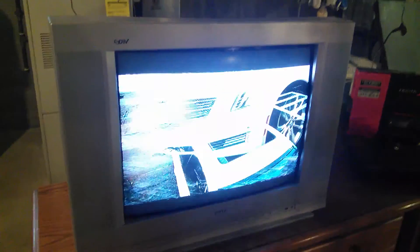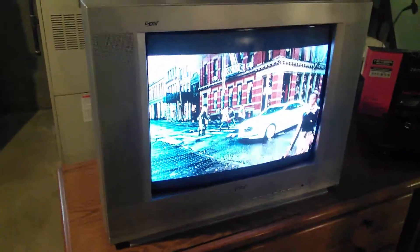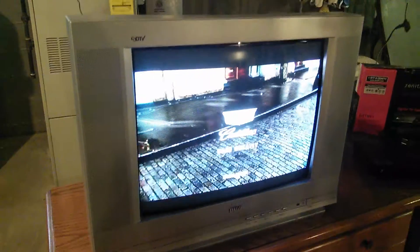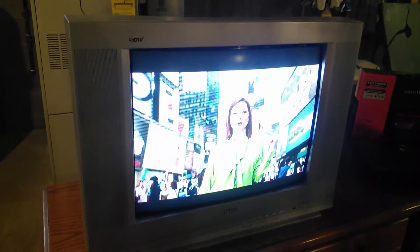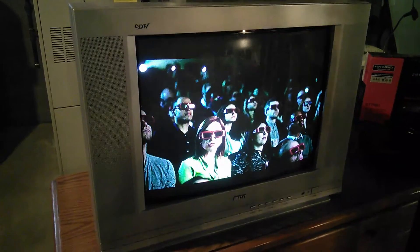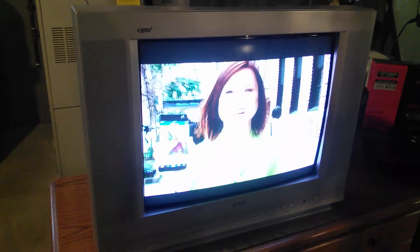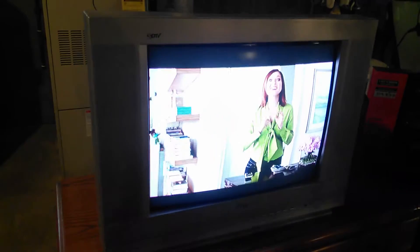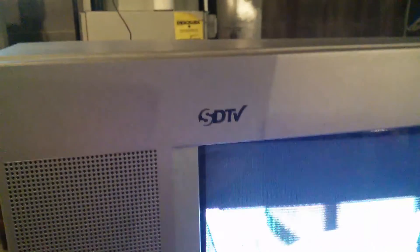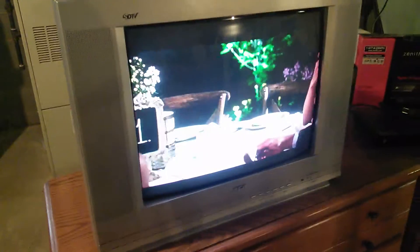Now if you're going to a yard sale, a garage sale, or a thrift store and you see one of these establishments has a CRT for sale, check the back. If it was manufactured after March 2007, it has a digital tuner, because the FCC mandated that all television manufacturers had to have a digital tuner in their television sets to get ready for the digital transition. So not only does it have a digital tuner, it also has an analog tuner as well. And the other way to know is to look for something like HDTV or SDTV on the TV — something like that will indicate that it's already got a digital tuner.